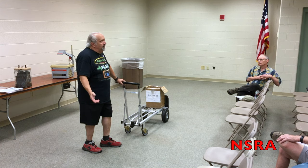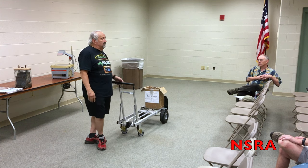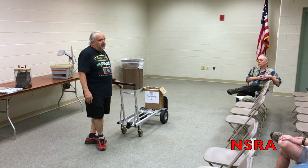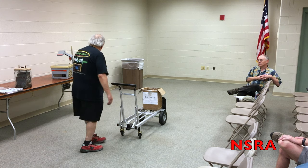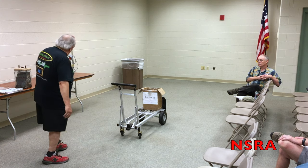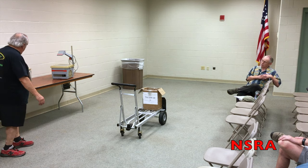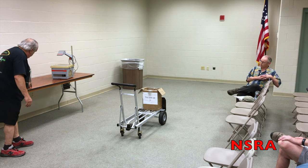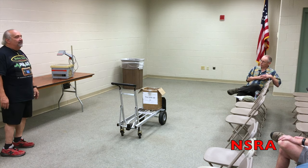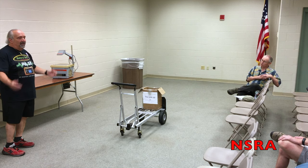I just want my stuff to start. Well, there are some things we can do. Now, what we can't do is stop the companies from making cheaper and cheaper batteries and trying to make them last a couple of years, because they could make a battery that lasts 80 years. Now, let's talk about a battery. This is before plastic. This is Bakelite and glass, with 3 inches of room from the bottom of the plates to the bottom of the glass. Why? So that the lead sulfate that falls down won't short out the plates.